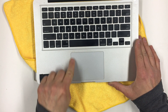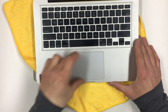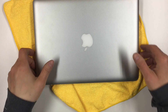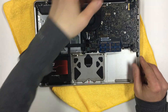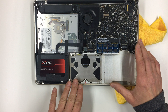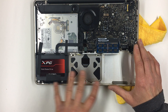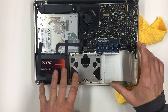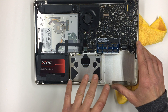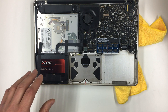Before, this wouldn't click at all. I hadn't used the computer in a while, and when I opened it up today you saw what it looked like — this was actually swelling out because of the battery. So I'm going to need a new battery for this computer. I just wanted to show you this MacBook Pro and what the swollen battery looked like. I thought that was why the trackpad was stuck, and obviously today when I opened it up it was in a really, really bad state. So I'm glad I got that old battery out. I'm going to see if I can get that recycled today. I'll do another video when I order a new battery and put that in, and maybe I'll do a full refurb on this MacBook Pro.